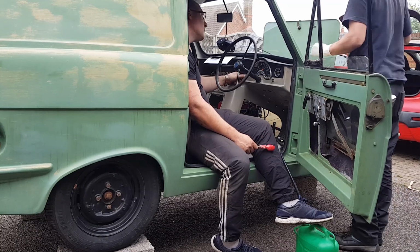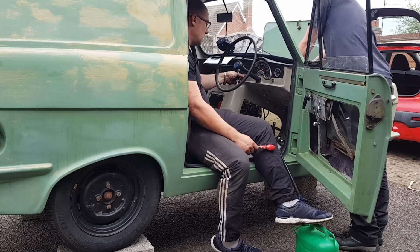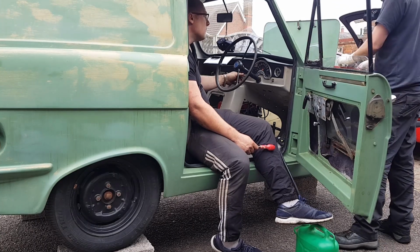See, nothing that time. As soon as you probe that coil, it comes on. Ready? Go on. Or not. Yeah, the points are working because the volts are flashing up and down on the coil when you crank it.